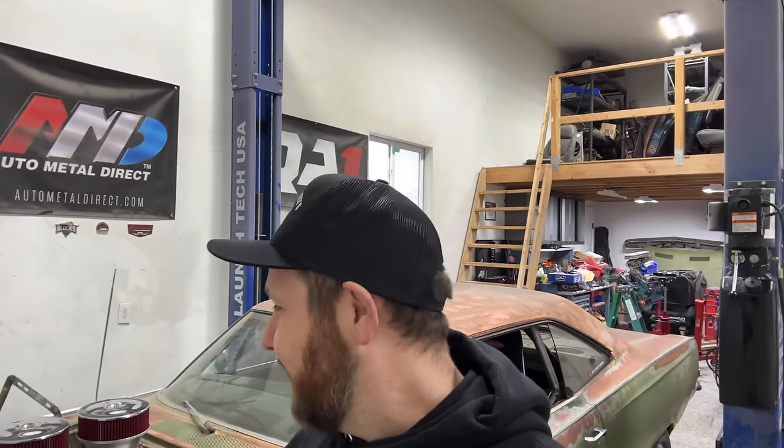But we've also got a hellacious transmission cooler leak that we definitely have to address. The aluminum fittings that are welded into the radiator, the threads are just completely wiped out on that thing. So we're going to end up running an external cooler that should be here tomorrow, so we should be able to get that done. And just a lot of little odds and ends, guys. But man, this thing came together, and in 3 weeks, we pretty much built an entire car.